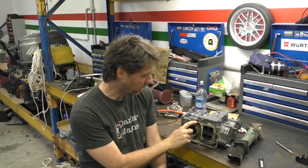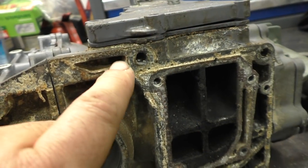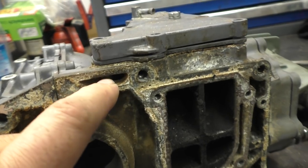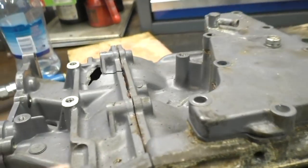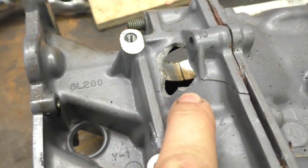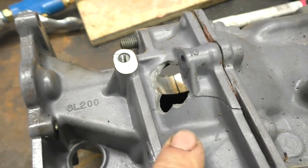Once the cooling water comes up from the pump, it enters this particular outboard block down here. The water comes up to this little opening and then in under this exhaust cover, which we'll be taking off as well. I just remembered — this outboard came from a Yamaha 20 that had thrown a bearing and put the rod through the side of the block.